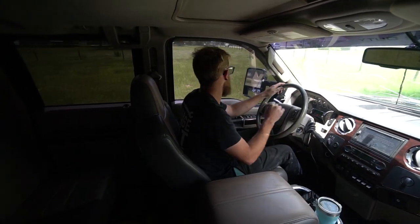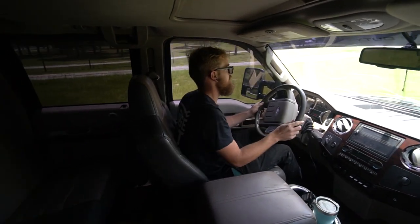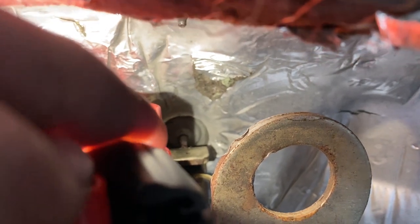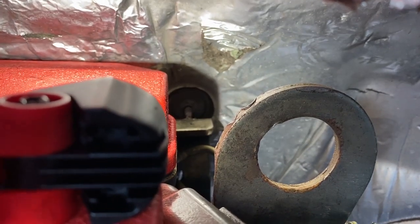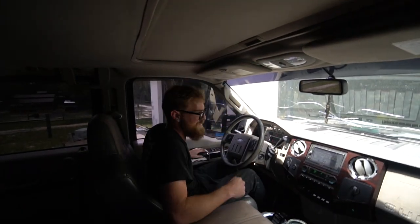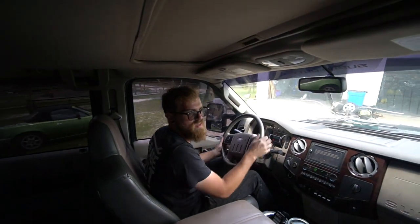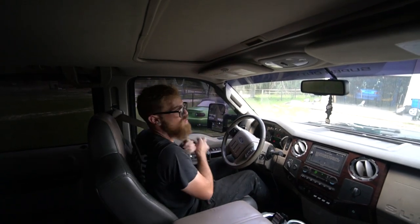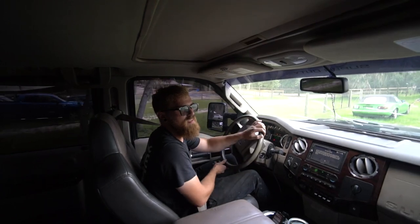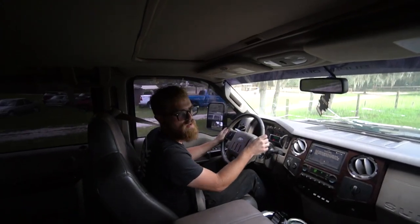That noise — it seems like it's holding first gear longer now. Before, it kind of wanted to shift to second immediately. You can see there's a stud right there touching that bracket, and I think that's acting like a stethoscope into the cab. I'm going to try to cut that off — should have done that before I put the motor in. Things you learn after you've done things. It's gone! Because diesels, if they make contact, they get so freaking loud. When I first started it, it had a noise that sounded like knock — it was an injection line touching another piece of metal. And there was another one touching the intake horn. Now this thing's quiet.